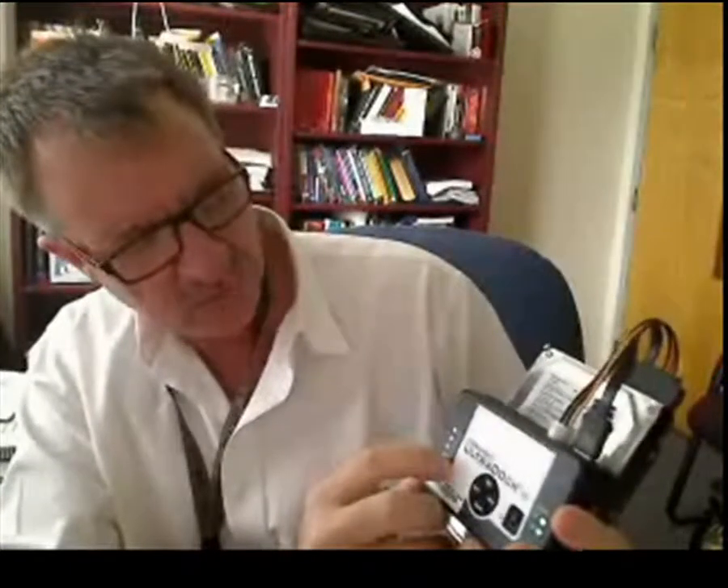You'll see that it has some indicator lights over here. There are arrows showing that write protection is being blocked — essentially what this does is stop interrupt 13, which deals with writing, if you've had my operating systems class. So it keeps anything from being written to the hard drive. Then there's an indicator light two below that which shows whether it's writing or not. Now I'm going to open up FTK Imager.